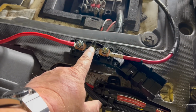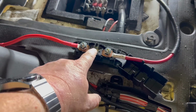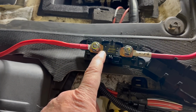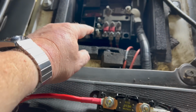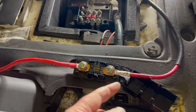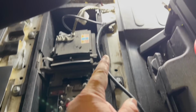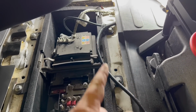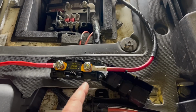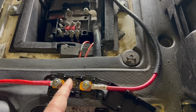So this is the cable that's going to feed into the Ecoflow, and at this end I'm just putting a fuse in, 100 amp mega fuse from the battery terminals there. And this is just to protect the fact that, hopefully this is shielded, then in conduit, and then in shielded conduit after that. So if it does come into contact with the chassis at any stage, then it'll blow this fuse.